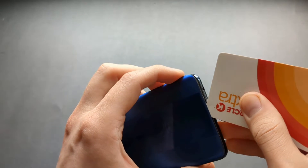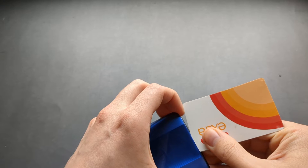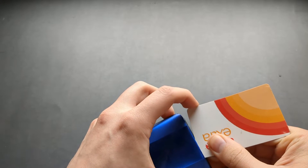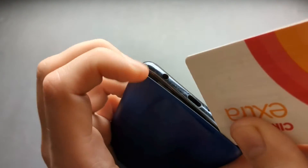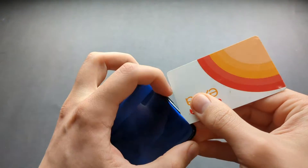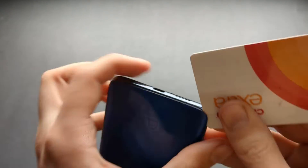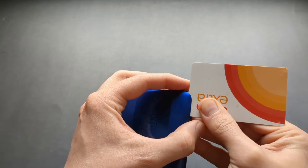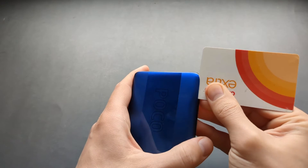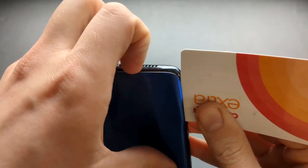Then we can take the card and insert it here and try to cut around — there is a layer of glue but you can simply slide it around by lifting the frame carefully. Keep sliding this plastic shim all around so you cut off the glue layer and break it, continuing all around the frame until it lifts properly and all the glue has been broken.